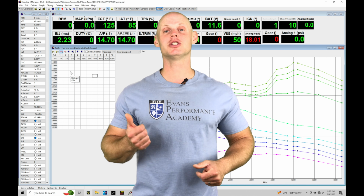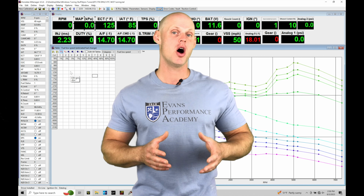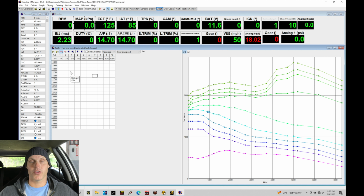Without further wait, let's jump into our live training session so we can finish up our calibration process on our low cam of operation. Welcome back to our live training session here with our K24 swapped Civic Si. In this training tutorial, we're going to turn our attention to dialing in our full throttle fuel and spark timing on our 0-degree low cam, or non-VTEC, operation.